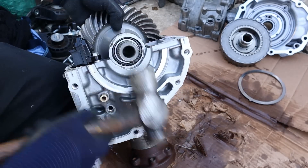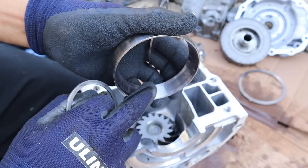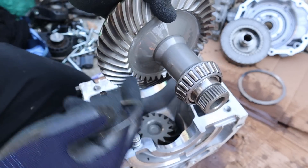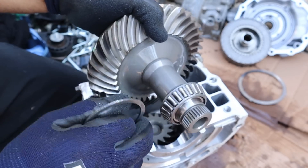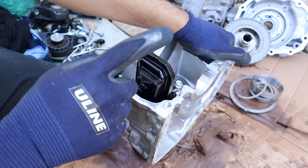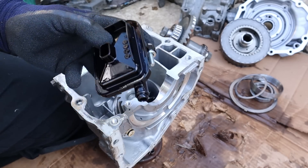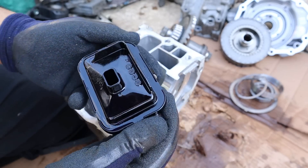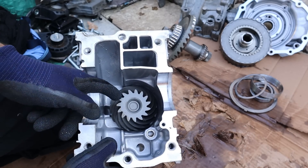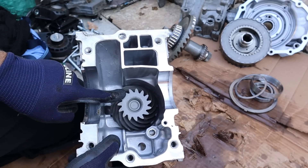Let's pop this straight out, and we've got the bearings of course — these have a bit of a conical shape to them. The reason these bearings have that conical shape is because due to the ring gear's teeth it's going to provide a little bit of axial forces, so you want to be able to capture that in the design of the bearings. At the bottom here we've got this little baffle slash filter thing. The temperature sensor used to hang out at the bottom here, and this basically feeds the oil pump that sat on the side. Yeah, it looks like that is a filter — very similar to the transmission filter, just a mini version of it. Finally inside of here we have the pinion gear, which is the input from the transfer case. It's helical cut in a spiral shape because it allows more surface area so you can transfer more torque, and it's also much quieter than using a straight cut gear.